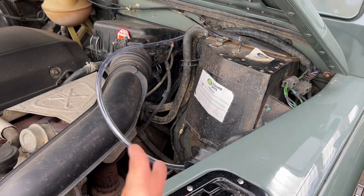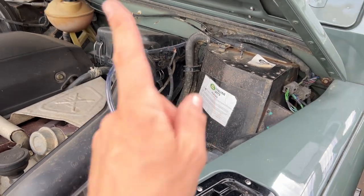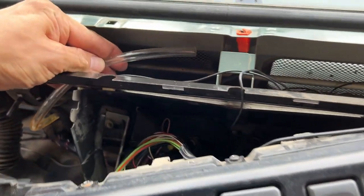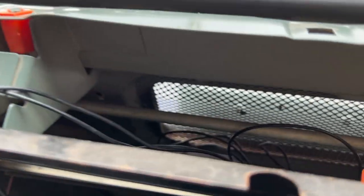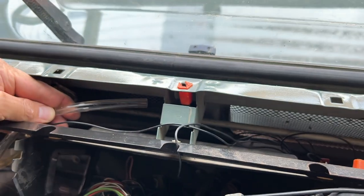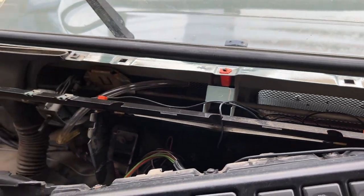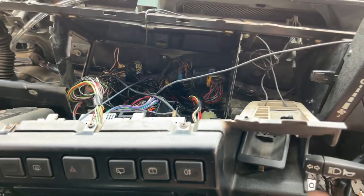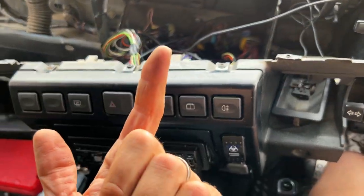For the new pipe through the bulkhead you need to open up another rubber grommet. I've gone through just there on the bulkhead, and from the inside you can see it coming through — then I've got a little connector to put it into the old pipe connection, and we're almost sorted. I didn't really want to have to but I've had to take the dash off to get access up to where the washer hose connects.